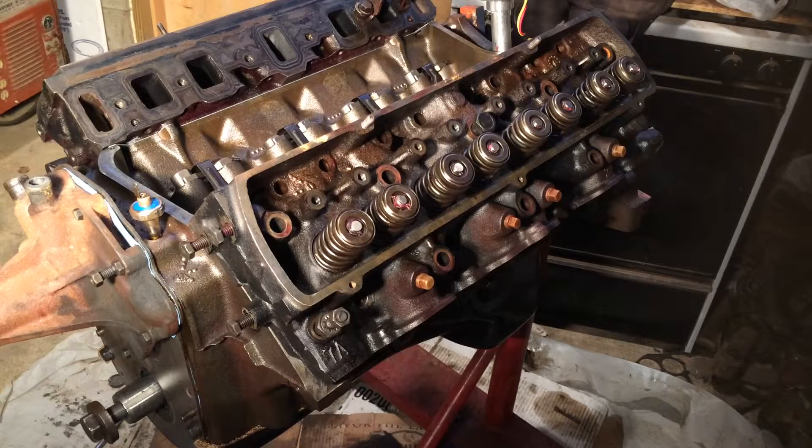That's pretty much the gist of it. Once you get all your bolts in, torque them down to 85 foot-pounds. You don't want to go just straight to 85 — do it in 3 or 4 steps just to ensure that it's going down evenly. So I'm going to go ahead and get this head on, and then I'll show you how to do the valve train on one of these engines. Very simple — no adjustments necessary for those. Alright, thank you for watching. I'll have another video shortly, hopefully.